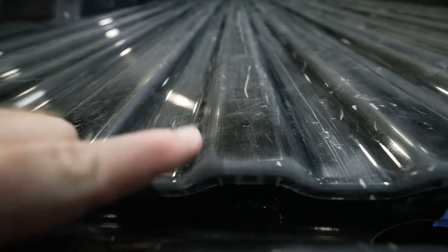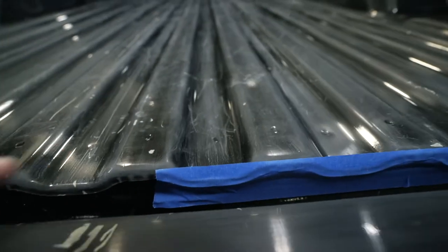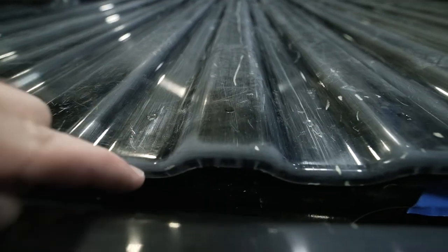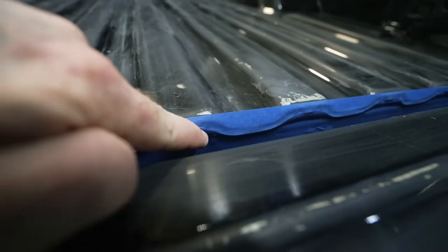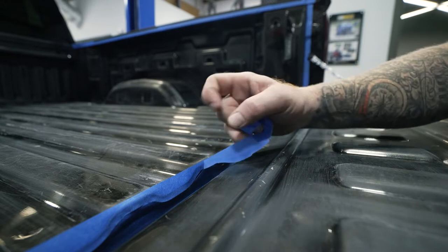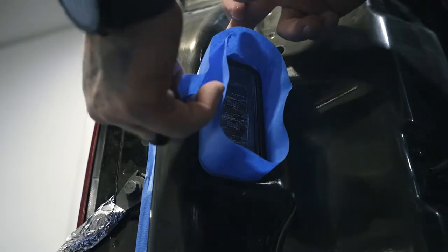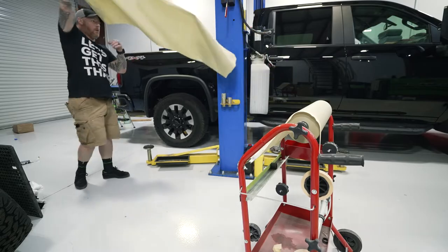At the very edge of the bed the sheet metal wraps over and folds over the other edge. I'm taping all the way up to the top edge and I'll come back with a razor blade and cut this off so the bed liner stops right on the edge of the sheet metal - that stays painted - and then the top edge is bed liner. It should have a nice clean look. After that I moved on to masking off the bed lights and re-taping the lines that define the edges, as well as masking off the exterior of the truck to protect it from overspray.